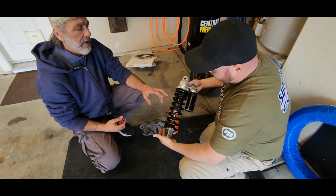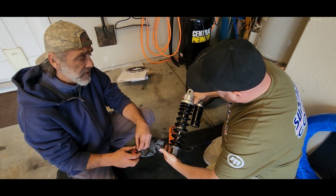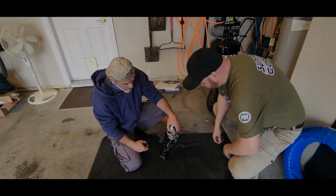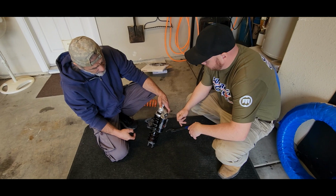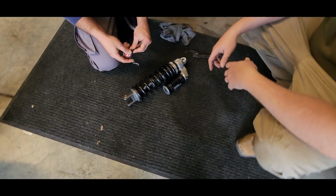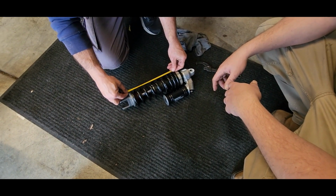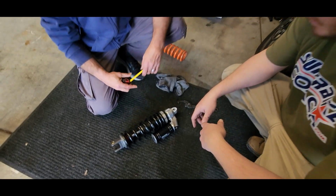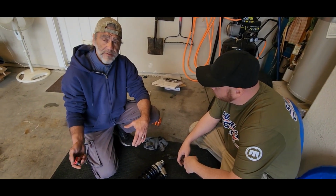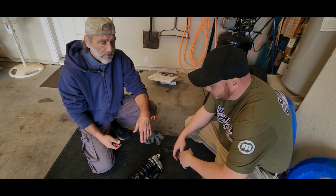So now Mark is going ahead and giving this tension by 10 millimeter. We took the measure, 260 mil. We should see 250 mil then. I think Mark did a great job here. It looks brand new, doesn't it? So before we saw 260 in free length of the spring, and now we're seeing 250 here. It's a little more, but that doesn't matter because we've got to set it up anyway. We leave this loose, throw it back in the bike, move on with the rest of what we have to do, and then once we're all done, we're doing the settings. Sounds good to me.